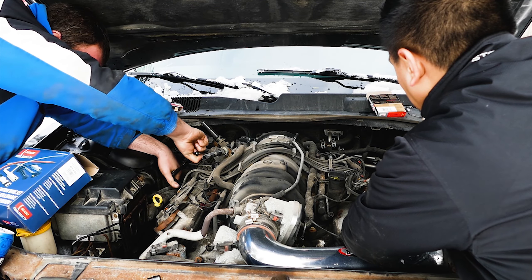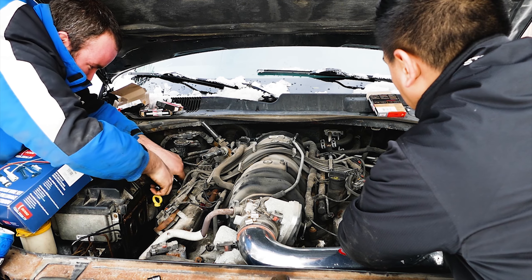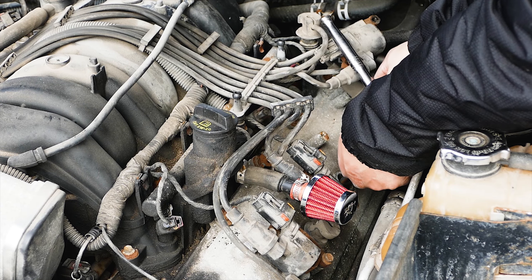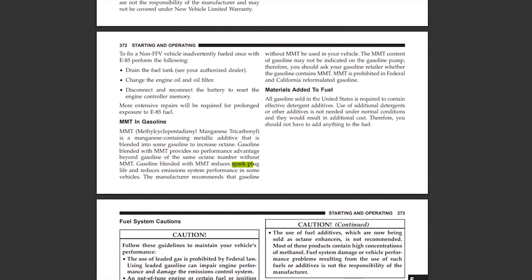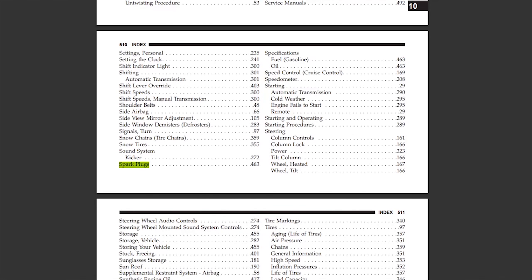This took me and Greg about 30 minutes to replace the 16 spark plugs. The maintenance schedule for spark plugs on the 5.7 and 6.1 liter Hemis between 2003 and 2013 is every 30,000 miles or 48,280 kilometers. For the spark plugs on the 2014 plus 5.7 and 6.4 liter Hemis, the maintenance schedule is every 96,000 miles or every 160,000 kilometers. For the 2014 plus Hemi owners, it literally states in the owner's manual to replace the spark plugs at 96,000 miles, so doing it any sooner than that is just a cool story.